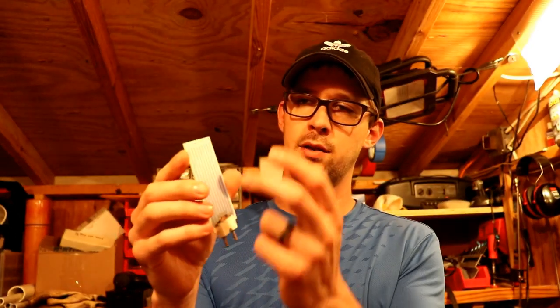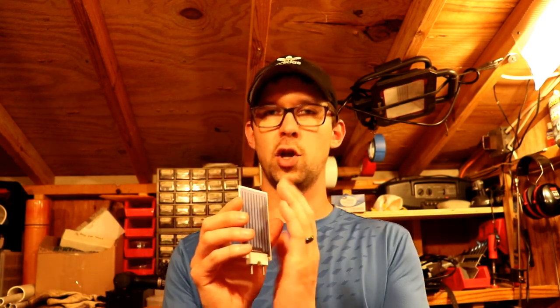The ultraviolet uses a UV light similar to what you might find in a water treatment UV light. But this one is a corona discharge. Corona discharge, if you don't know, is the effect that takes place when there's so much electricity — so high a voltage in a conductor — that it actually ionizes the air around it. If you've ever stood beneath a high voltage transmission line and heard that slight buzzing and popping, that's actually a corona discharge effect taking place. It's similar to static electricity at a technical level. On this little ceramic plate there are two pins coming out of the bottom and a series of conductors that interact with each other and create essentially a zone of ionized air, which in turn turns O2 into O3, which is ozone.